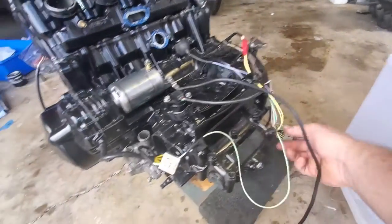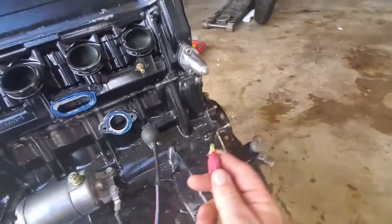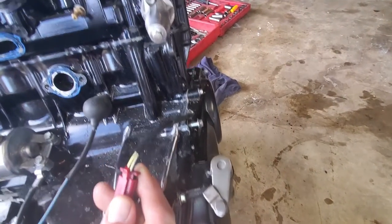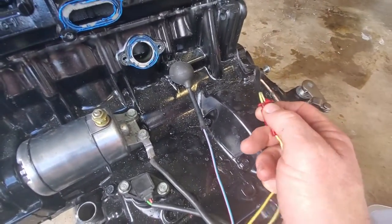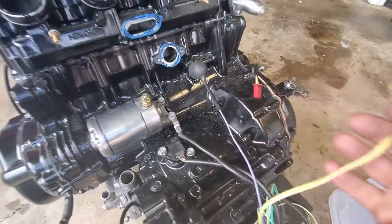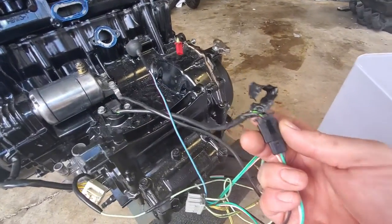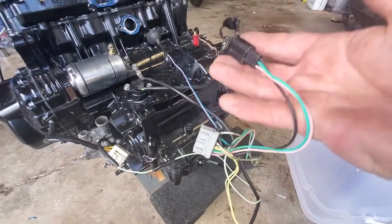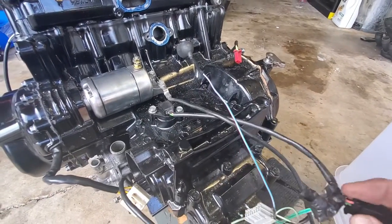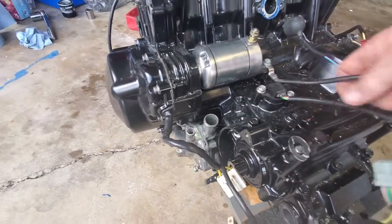I think we're ready now to take this wiring harness off — there are several places where it connects here. The first place is this red connector with the two yellow wires that goes around to the right side of the engine. Inside this housing is the crankshaft sensor or the pulse generator — that's what these two yellow wires with the red connector go to. This is a simple pinch connector. There's also this connector here that goes to the speedo sensor — the speedometer sensor.